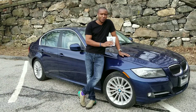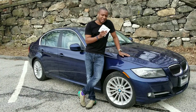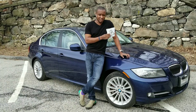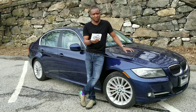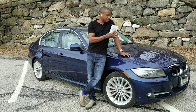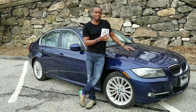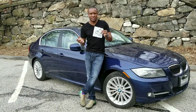When I bought my car it wasn't even 4 or 5 years old and had about 40,000 miles on it. The car was leaking oil from this gasket — I didn't realize it until about the second year of ownership when I took it to the dealership and they explained the gasket was leaking. I did change the gasket on my E46, an M54 engine — it was so easy I'm not sure I even made a YouTube video on it. It took me a few minutes in freezing cold. On this car, the gasket is fairly easy to change, but there's a lot of work removing engine cover components to get to it — specifically to reach one bolt that's hidden under the intake manifold.